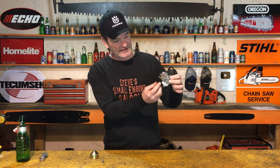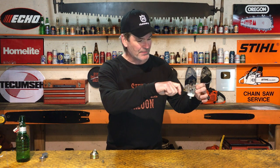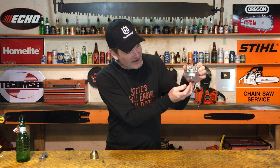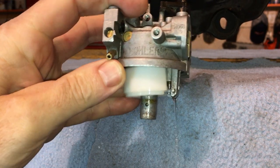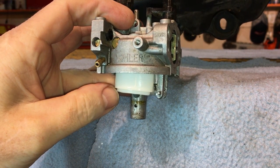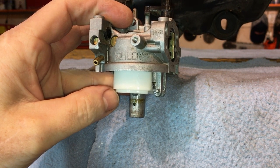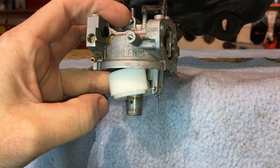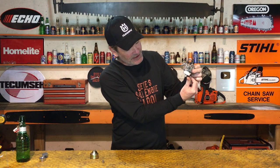You can actually test this before you put it all back together. Leave the bowl off, put it near your unit, put your fuel line back on and open it up. You're going to see fuel pouring out. Lift that float up until it's level — if that stops the fuel, you just fixed the problem. If fuel keeps pouring out even when you lift the float way up high, there's still a problem. Maybe the groove around the tip of the needle is too big, or there's still something wrong.